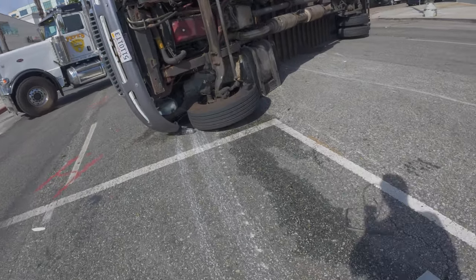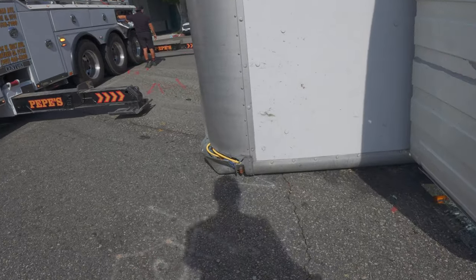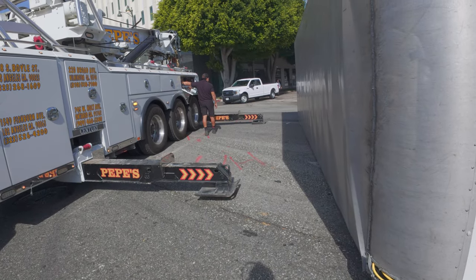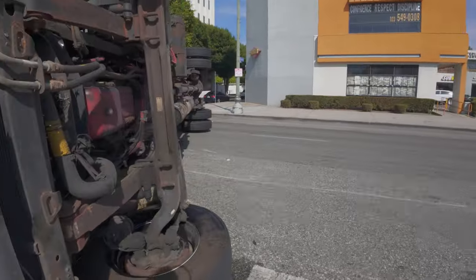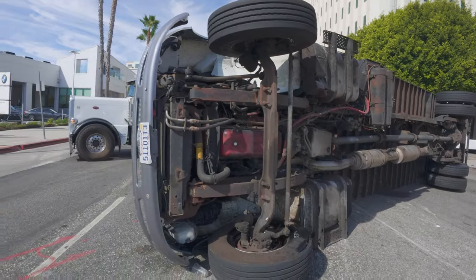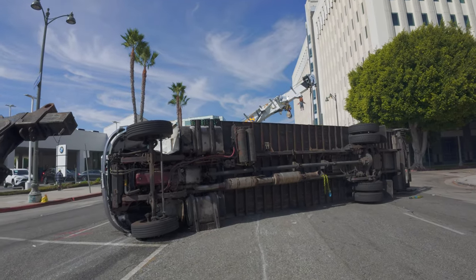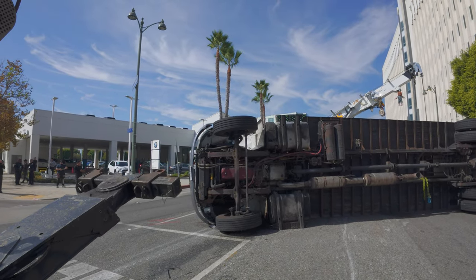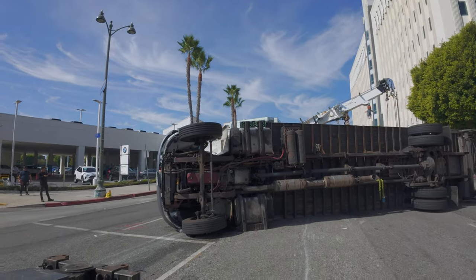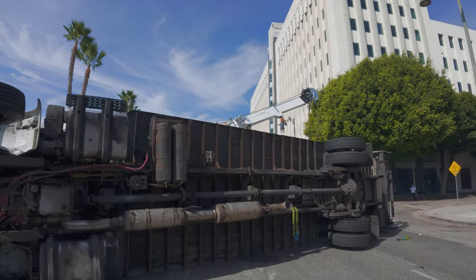This is a very weak wall, so Alex is going to be using straps. What I can start doing is back up to it and pull from the front axle. That way Alex only focuses on the box, and the chassis stays together through the whole upright. With these box trucks — the box is on a chassis. If you control only the box without paying attention to the chassis as it comes over, you can tear the box off the chassis.